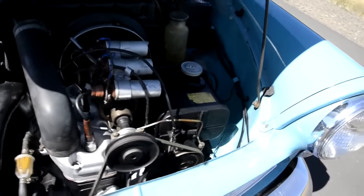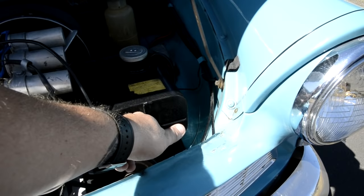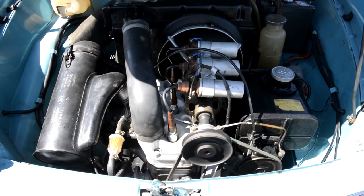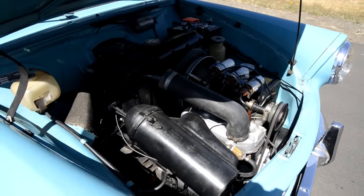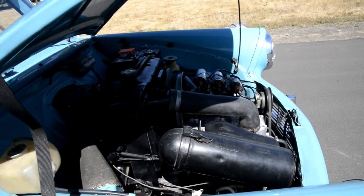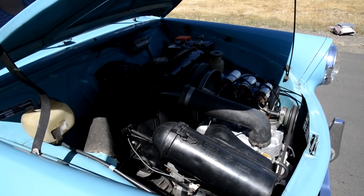And the way that pump works in there, it just turns a little thing inside, and it lets just a little bit of oil go into this line. You want to make sure that line has oil in it all the time. There's a light on the dash, but anyways, it drops into the bottom of the carburetor and makes sure that it's mixing with the gas. So, very cute. Just to give you one little look around here. This is a windshield wiper squirter. It's not working. But there's a lot of little tiny things to sort out, all the fun stuff. But overall, you got a really clean little car and something you can drive around and tinker with.